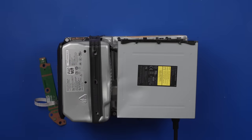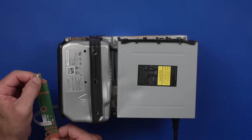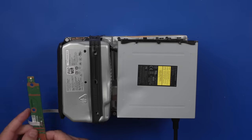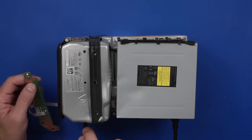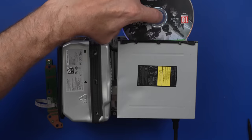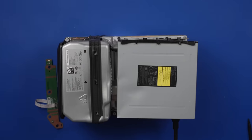Plugged into power. I hear some buzzing noise out of the power supply. Just no power to anything. It could be this connector down here — with pressure on that, still nothing. Tried the disk drive, no power there either. I do suspect probably a problem with this power supply. The next thing we need to do is just get this all torn down and have a good inspection of everything.